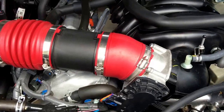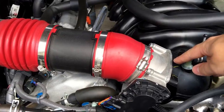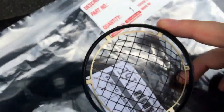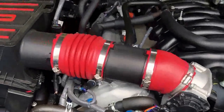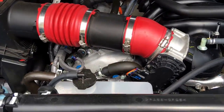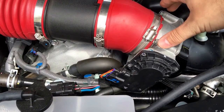If it does, the fix is right behind the throttle body here. There's a little tab that has a gasket in it, and this is what the gasket looks like — it's got a honeycomb pattern. What happens is the high-flow air going through it makes a whistling sound. So the fix is you have to pull up the throttle body — the four bolts right here.